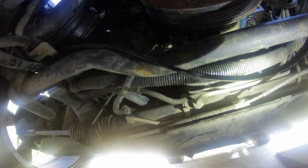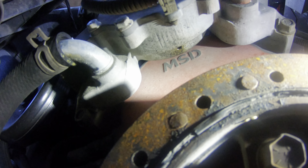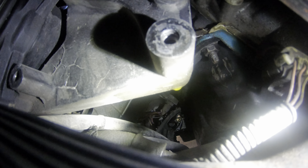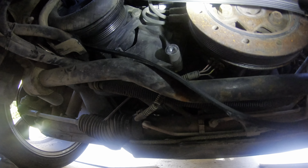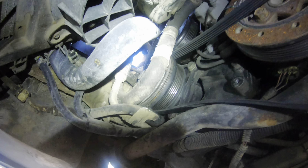It's always good to get on your car every once in a while. I didn't even notice this before - I see a little wetness right here. I thought it was oil but it's not, it's coolant. So the weep hole is leaking on the water pump. I took that tensioner off and there it is right there. I'm going to inform the customer we're going to be doing a water pump on this thing too. Not that big of a deal - pretty easy, like three 14-millimeter bolts. You just take this fan out - it comes right out, really easy to do, just time-consuming.